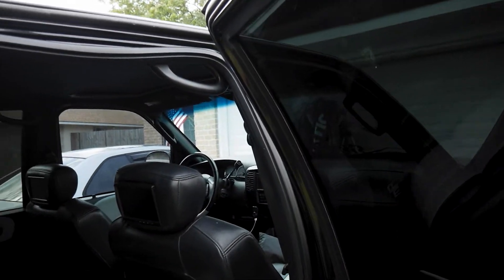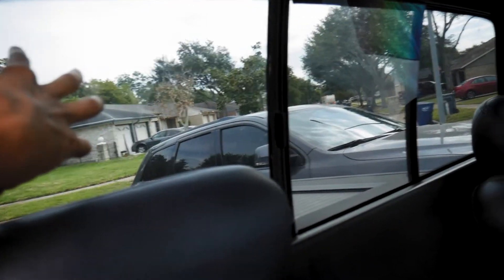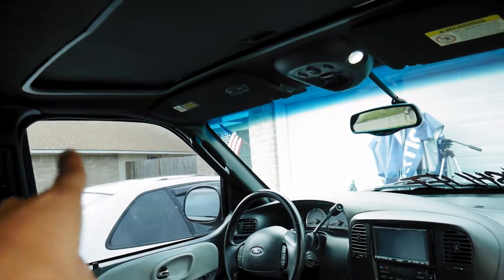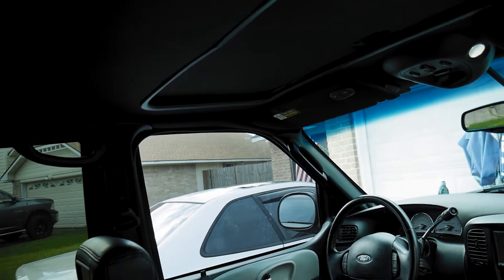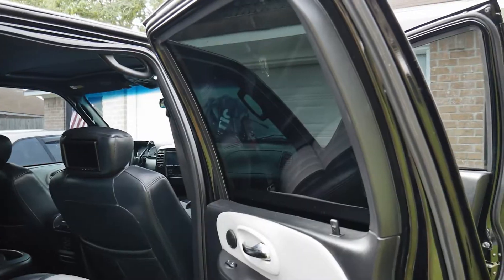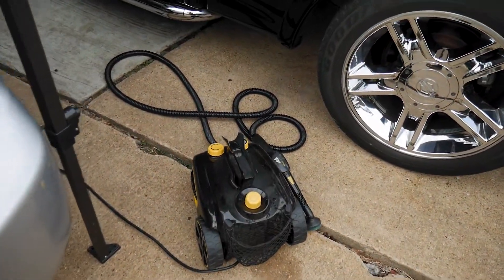So we're going to have to remove the old window film. I'm thinking about putting 5% on the rear and then a 5% with the 50 combined, and then on the front glass just a 5%. It's going to be pretty dark — I might change it out later — but going to see how I like it. I think it's really going to suit the truck, being a sports luxury type of truck, really give that privacy and block out that heat. I have the tint all set up and my steamer filled up, waiting for the water to get hot.